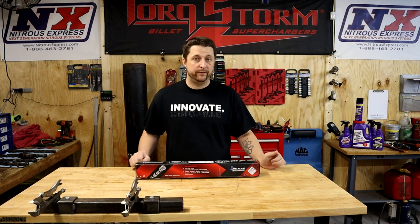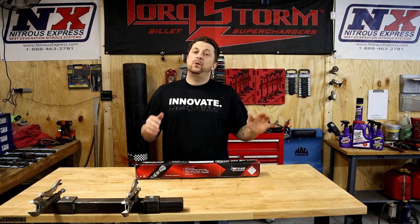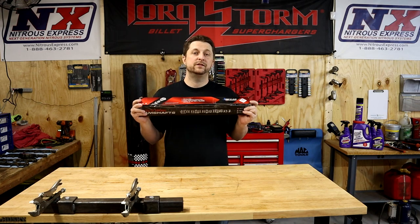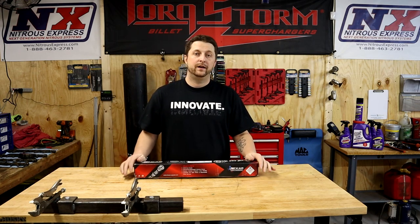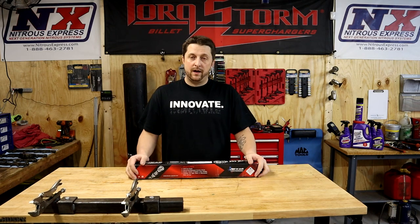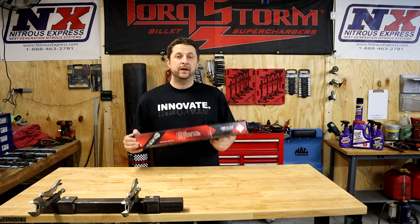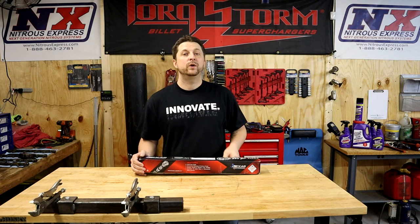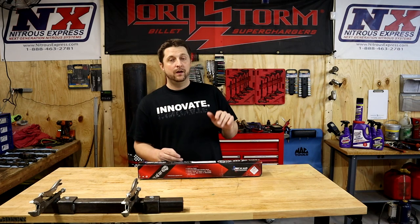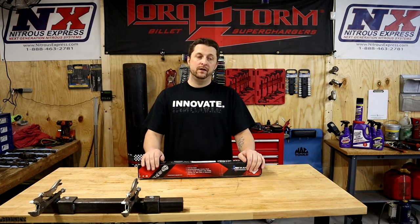Before we got to where we are now — actually racing the truck a lot and modding it — I wanted a new camshaft with a little bit of power gain, but at that time I wasn't planning on doing a stall converter. So we went with the J Green point-five cam. That's what's in the truck and what we are removing now. This cam from Dr. Differential and Speed Shop — his Enforcer camshaft — is designed specifically for a boosted forced air build. This camshaft is a 224 intake and a 230 exhaust, which is a massive difference compared to the point-five cam currently in the truck.